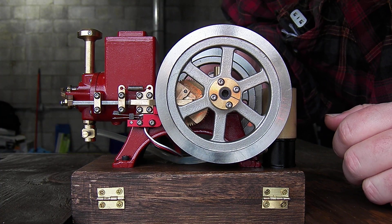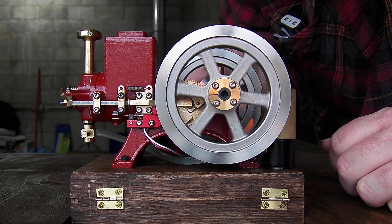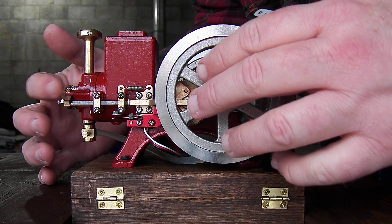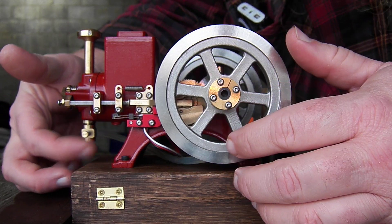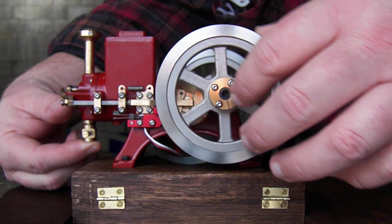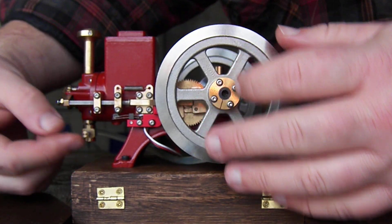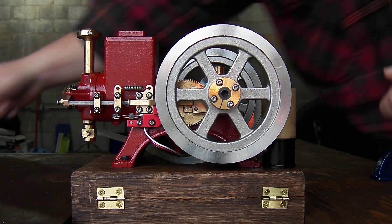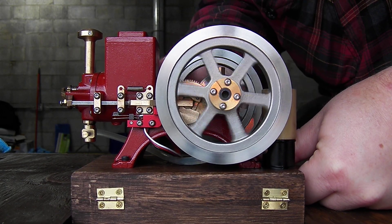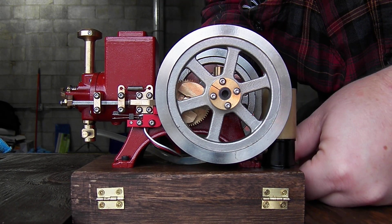Okay, as we keep trying stuff — last time we did this, it was running a little bit faster. The engine was running faster than I wanted it to, so I'm going to try to change it. What I did to change it: I actually put the super soft spring back in it, but because I put those washers under the fly weights, those are moving a bit more now.